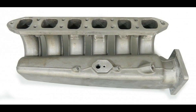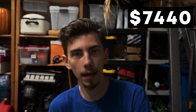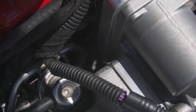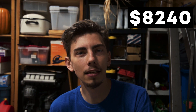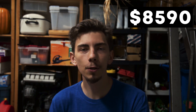The intake manifold is a Road Motorsport intake manifold for the 3.2-liter VR6, which I modified to work with the 2.8-liter. I port-matched the cylinder head since the ports are different sizes and smoothed the transition. I also ran a 3.2-liter throttle body spacer — a flange typically used to make a 3.2 VR intake manifold that I drilled the threads out of and turned into a spacer, making my own gaskets. It cleared the fuel pressure regulator on the fuel rail. That part was $800 Canadian all in.